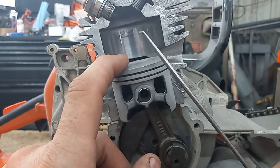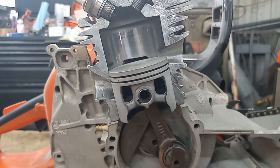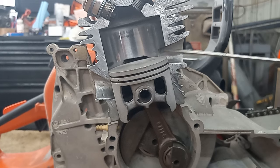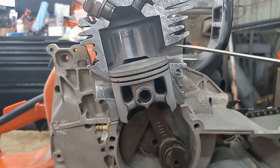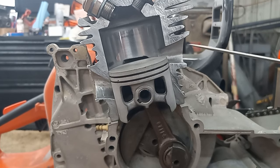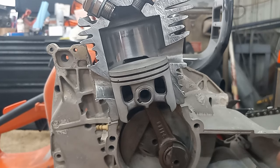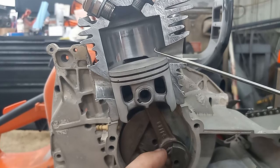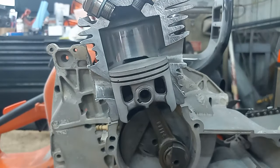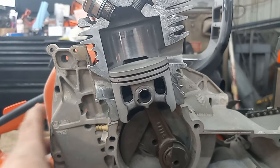Another thing that can help — I do my exhaust ports typically different, especially on my 4910 and 7310 builds. I'll widen them out just a little bit in the back but not much, and I stick with the stock port taper design so I don't have to match the gasket or manipulate the muffler — cuts down on headaches. I shoot for high port velocity. If that exhaust is screaming out at a high rate of speed, when that port cracks open, it will actually pull fuel from the crankcase up the transfers and across the piston into the exhaust port.